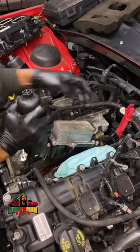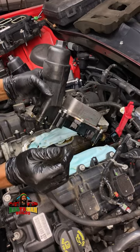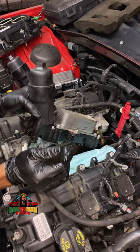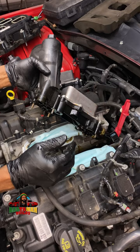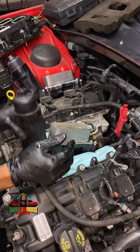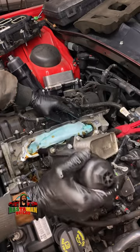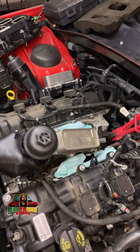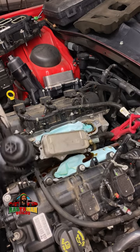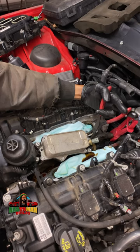So what happened is, when you pick this oil filter housing up, if you didn't drain the cooling system down below this level, the coolant starts oozing out of the openings and then goes down into the oil system. Make sure to drain the coolant first, or you will have to do an oil change after this — you're going to be doing an oil change anyway.